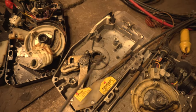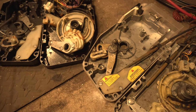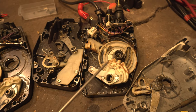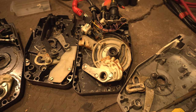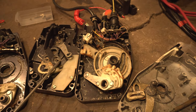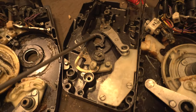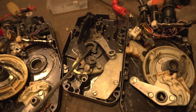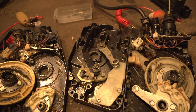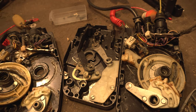The other issue was that the choke lever was extremely difficult to move — I was afraid to force it, thinking I might break a part that isn't cheap to replace. But it turned out to be extreme corrosion on the inside. There was actually nothing wrong with the lever itself — it just needed grease. It hasn't been put back together yet, but there isn't actually anything wrong with the part. So it's good to take it apart and just see what's going on.